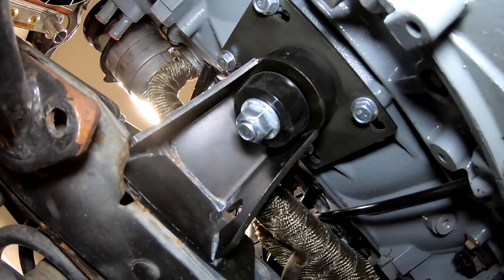There's one more thing I wanted to address on the motor mounts — a simple fix, not a huge deal. The motor mounts for this conversion are basically two urethane isolators, an upper and a lower, with a carriage bolt through the middle, a nut and washer on the bottom. The nut they provided was a five-eighths prevailing torque nut, which is perfect because you don't want to completely clamp down on the isolator since there's no steel bushing through the middle. But the washer they included is just under an inch in outside diameter, while the flat spot on the bushing is about two inches in diameter. When the motor torques back and forth, it could easily pull that small washer into the urethane, which is not a good thing.